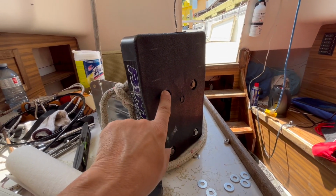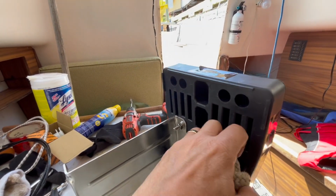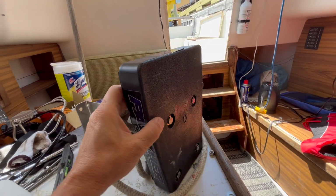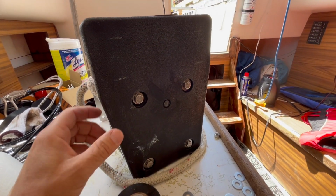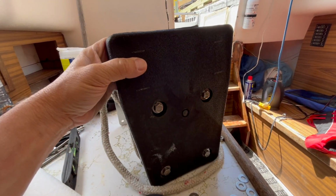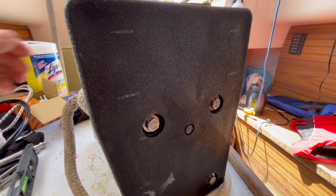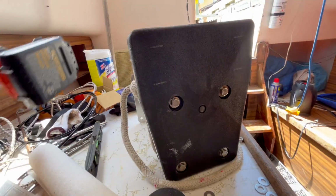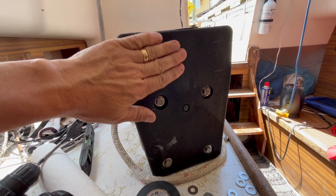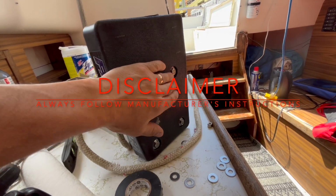Really, you need something here that you can grab like a hex nut. Then you can really tighten your bolt through, get a good torque on it, and tighten the mounting bracket onto the whatever these things are called. So what I had to do was buy new bolts with a hex on this side and on the other side, so you can really tighten it in. What I had to do to make that work okay, because you need a countersink, particularly on these up here, because your engine is going to come down this far, so you really can't have this nut sticking out a little bit, because your engine back is not going to sit flat on here.